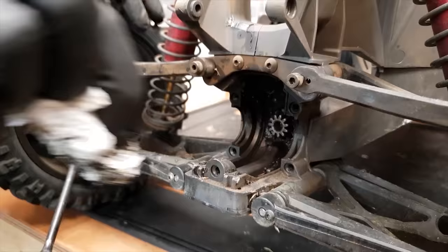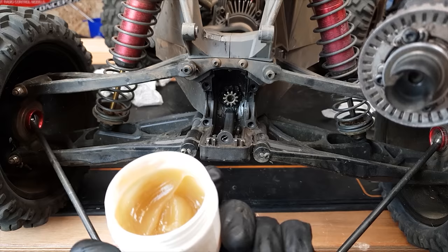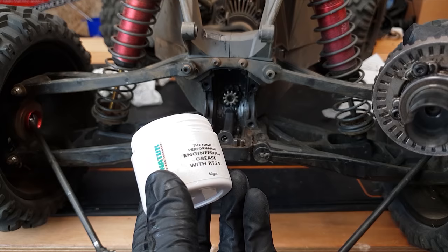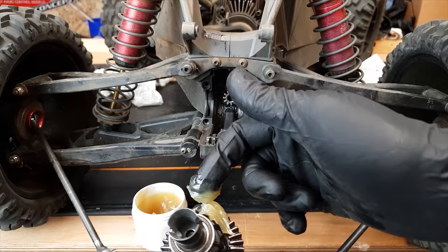I'm going to turn the camera off to clean that up — it's going to take me a good 10 minutes. All right, that's all nice and clean in there now. People always ask what grease I use — to be honest you can use any general purpose automotive grease like bearing grease. This stuff's got PTFE in it but it really doesn't have to. Any general purpose grease will do. Get a nice dollop, put that around there, and fit the brand new diff cover.